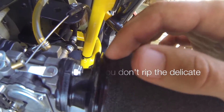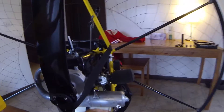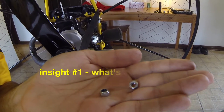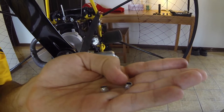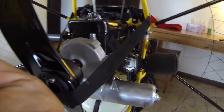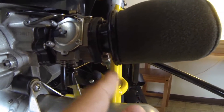I think I might have pulled it a little bit right there, but pretty good otherwise. By using an 8mm wrench to take off that bolt and that bolt right there to remove this little air filter. The nuts that came off — you can see a little blue thing in there. This is called a nylock or a nylon nut, because that little blue thing is supposed to make it a little more secure. Once you tighten it down, it grips onto the threads of the bolt. And you can see there's a washer there and a washer down there.